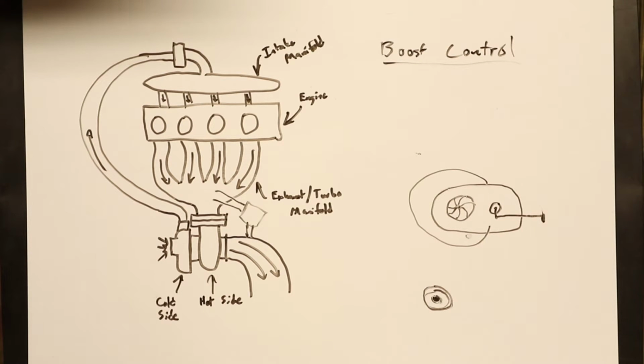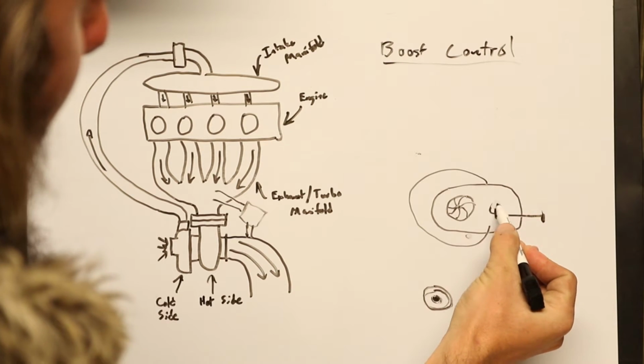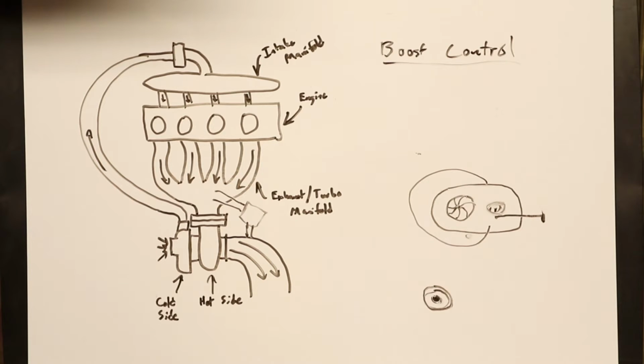And that's with an 11 pound, I think it's either a 9 or 11 pound spring in the wastegate. So obviously I'm having severe boost creep issues. So what we're gonna try to do is take the turbo out, take it apart, come in here and actually make that hole bigger so it matches that flapper valve better. And maybe we'll take a little bit of material off the backside of the wastegate actuator just to allow it to open a little bit further so yet again more gas can get by. Let's do it.